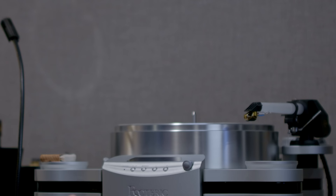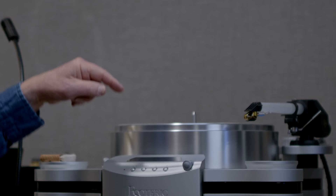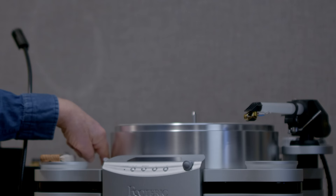They say there's nothing new under the sun, but this Grandioso T1 Esoteric turntable is something new under the sun. It doesn't have a direct drive, belt drive, or idler wheel drive motor. It has an induction-based spinning system — a motor controller unit with a motor, totally isolated from the chassis and totally isolated from the platter. On top of the motor is a cylinder with north-south poles; when it spins, it affects a magnetic strip at the base of the 42-pound aluminum alloy platter, causing rotation. There's no physical contact with the motor.